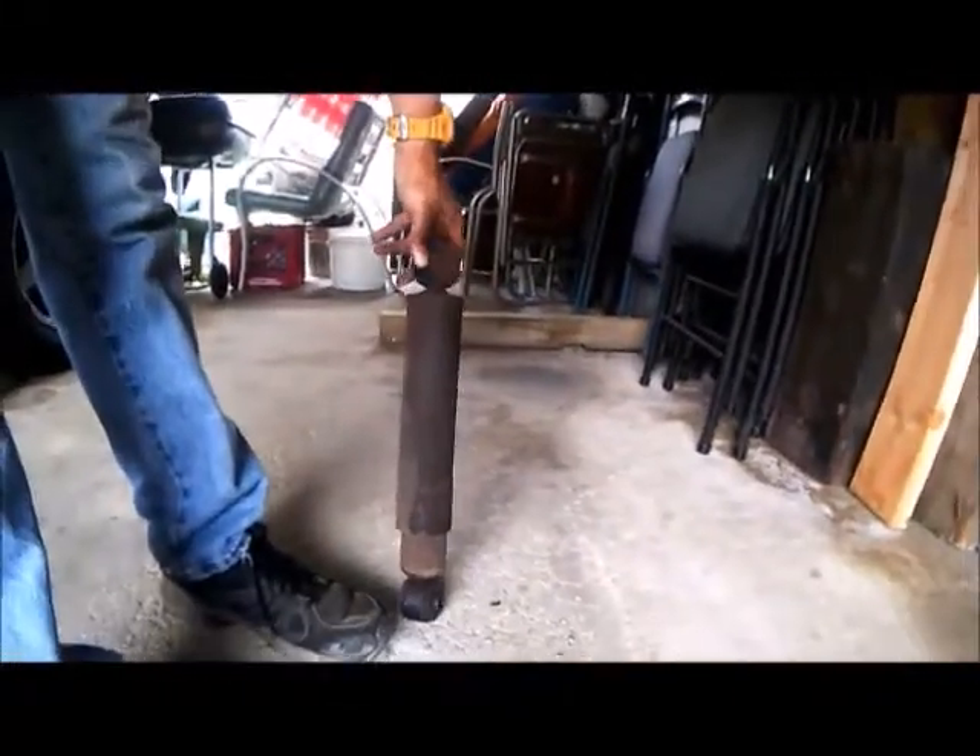I had to knock it off with my hand, then bring it down underneath the emergency brake line to get it out. The other one is longer so it's a little rougher to get through. One thing I wanted to show you while replacing them: this is the shock fully extended as it should be on the van, and if you press on it it just goes all the way down and doesn't even come back up — that's why I had to replace it.